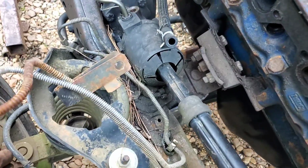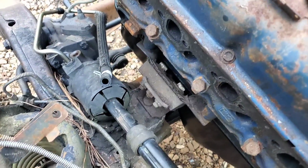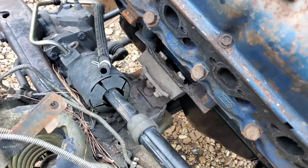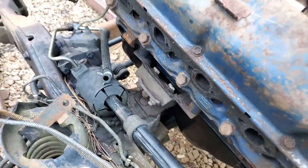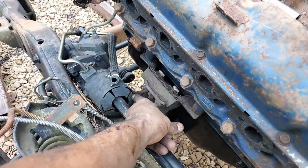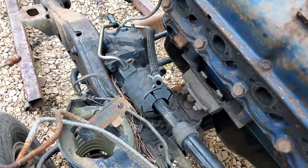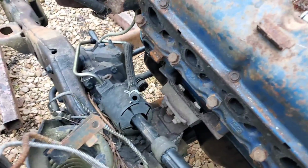And then, in that case, because they are going to be more or less permanent mounts, there really isn't the concern with replacing motor mounts. All the stuff would just be stuck together. And by having it situated just like this, once I get my cross member done and everything is situated exactly the way I want it, I just weld all of this area right here, and that way everything is permanently fixed at the angles that it is currently in.